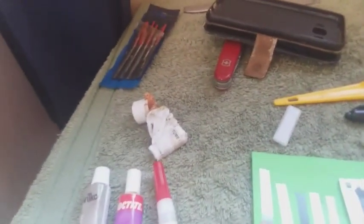On here I've got five different sizes of valves, and you choose the size to match the size of the reed. You want the valve not to be too wide — so it doesn't go over the edge of the reed plate — not too long, but not too short either. It's got to go right to the edge of the slot. Once you've got the valve on, you can trim it as well if you have to.